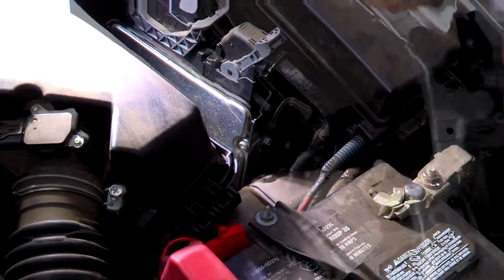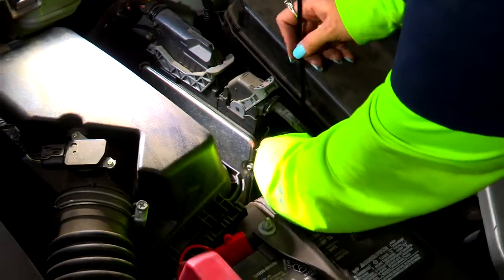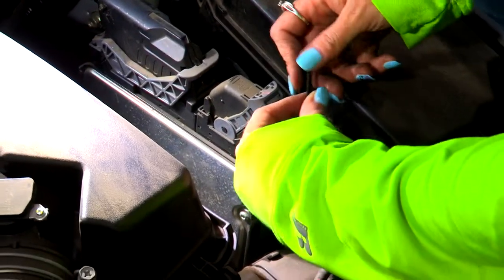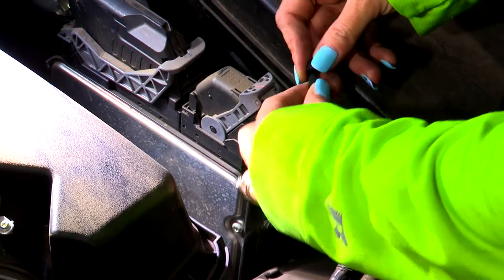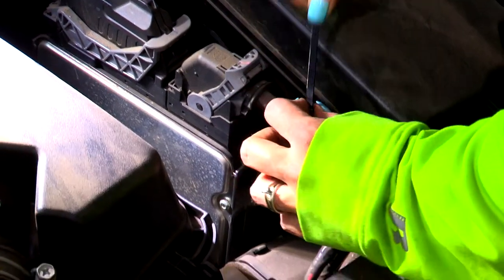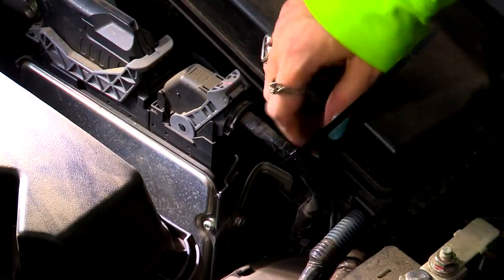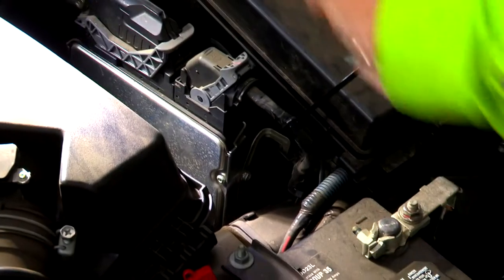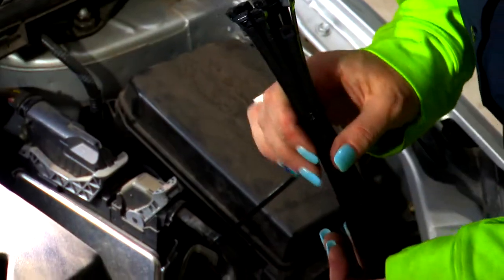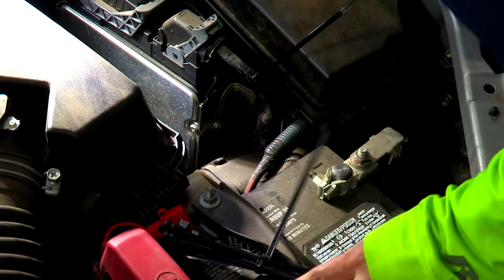You're good to go — all powered up. As we clean up from front to back, we're just going to take some zip ties and secure our wiring from front to back. It is best to use as many of these as possible. This is going to ensure that your power wire doesn't fall and doesn't touch anything hot. Always keep some of these handy.